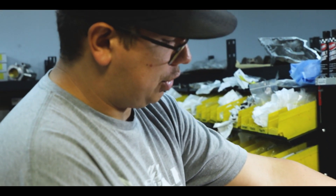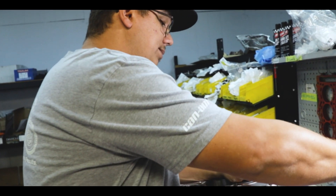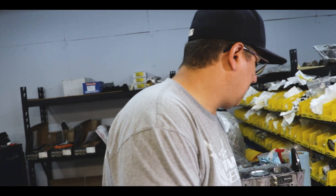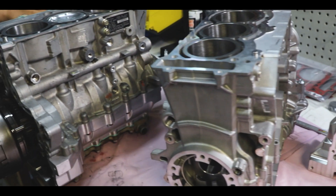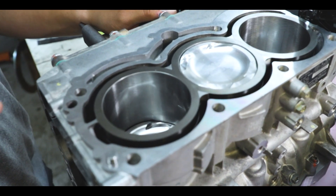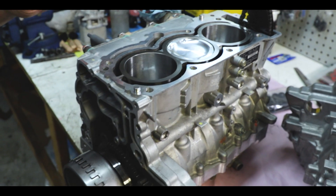This is the V3 version, and it's going to be mated to the bottom of our billet block. We've made some provisions for that, and there's going to be some really cool stuff. We're planning to have that released at the Sandsport show. This is basically an assembled V3 — it's a stroker setup. We've done the whole nine: it's got the billet girdle on it, sleeves installed. This is a 20-over, 73.5 millimeter stroke, 961cc engine. This thing is going to be rocking out pretty soon in a client's car.